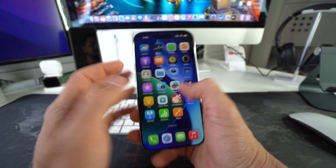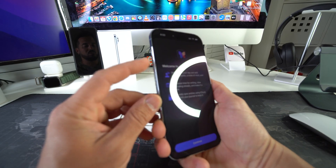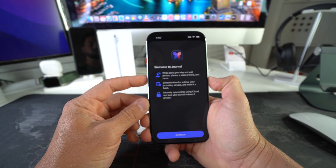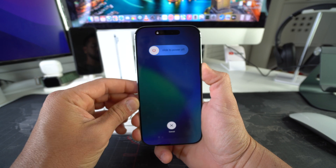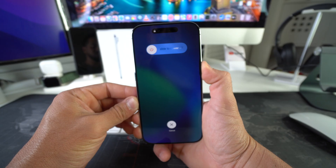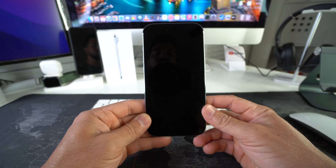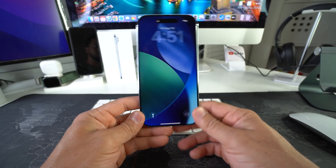From any part of your phone, let's say you're stuck on an app like this — all you have to do is press volume up, volume down, and then press and hold the Siri or power lock button. So volume up, volume down, press and hold the power lock button. You'll probably see the slide to power off — just continue holding until the phone blacks out. Once it does, release and give it a few seconds, maybe a minute or two, and the reset process will continue. It will show the Apple logo as it boots back on.